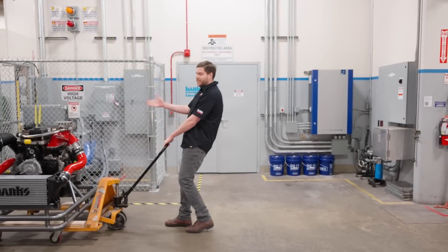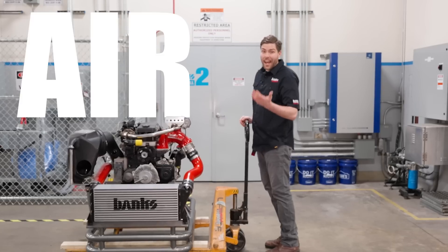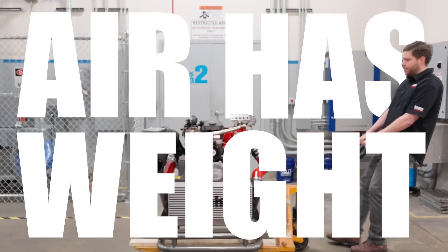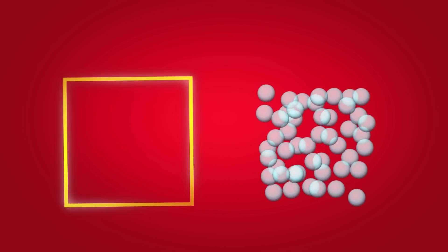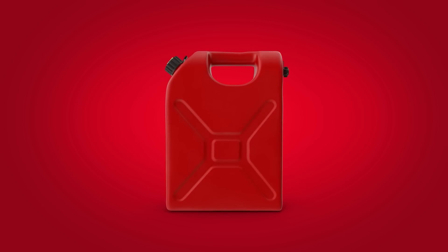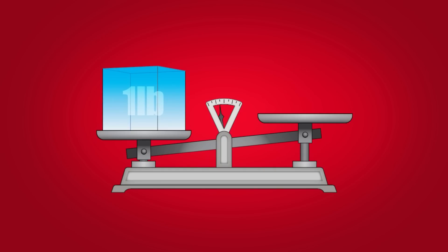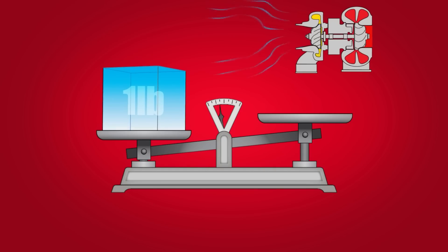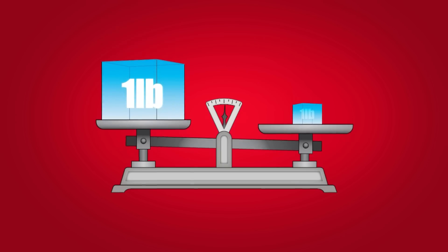Modern engines need to set air-fuel ratios based on mass, not CFM. And why is that? It's because air has weight. Mass airflow is the weight of the air passing through your intake system, engine, and exhaust over time. CFM is the volume over time, and mass airflow is the weight over time. Measuring by CFM is like having a five-gallon gas can without knowing how much gas is in it. Because air is compressible, the volume a pound of air takes up can change. As air gets compressed in the turbo, supercharger, or the combustion chamber itself, the volume it occupies gets smaller, but the weight never changes.